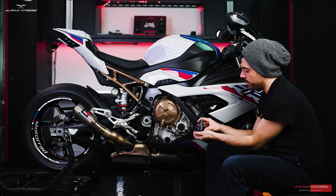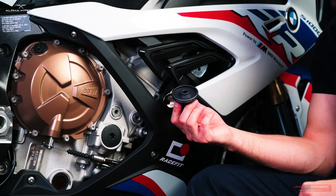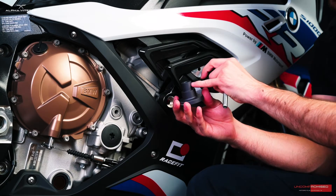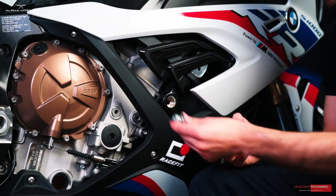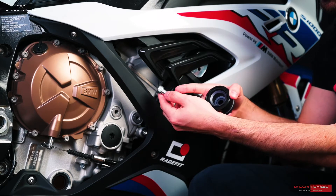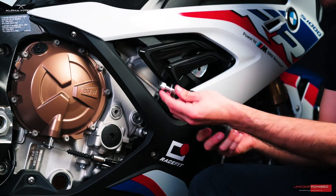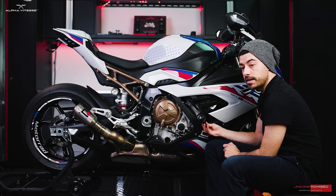Go ahead and grab the appropriate adapter. Left and right are slightly different — refer to your installation manual to tell you which one to choose. The right side has a slightly longer last step. Grab the puck and one of the bolts from the kit — both left and right are the same. We have a washer and also a spacer; make sure your kit comes with a spacer, which goes right after the washer.